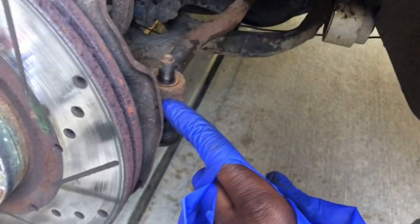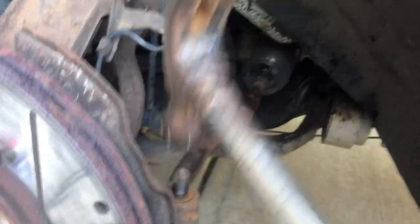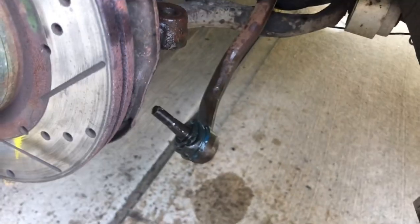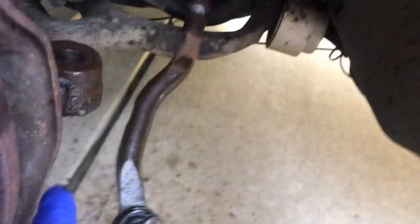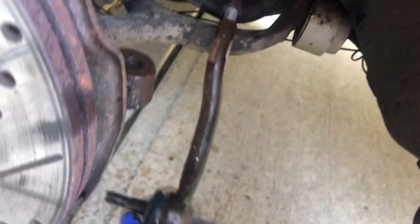Crown is off, jam nut's unlocked. Now you want to get like a light little tap — mine's a little rusted, so we're going to spray something around here, let it sit, then whack it again after a few whacks and get it back out. Keep the steering the same so you won't knock your wheel out of alignment. Then this just basically screws off — as you see, we released our jam nut, now this just turns and turns for us.